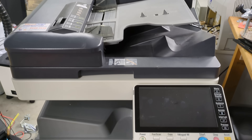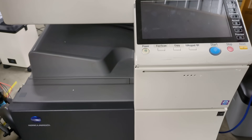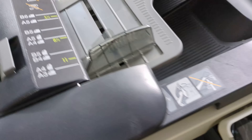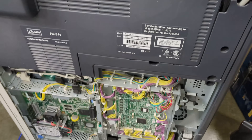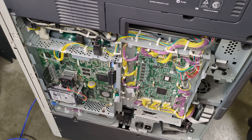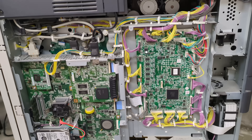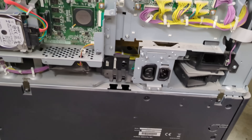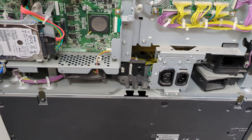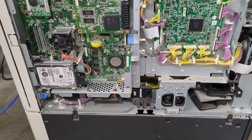Just an update video on this Konica Minolta BizHub that I scored from the dumpster — it's a C284E, colour jobby for those playing along at home. Does it work or not? Got it back here into the dungeon and... wah wah wah. It does absolutely nothing at all. So I took some panels off. I did actually find a service manual for this thing — believe it or not, it's 1,500 pages long. I am not kidding. It's insane! Haven't had a decent look, but I can't actually find the info for how to service the power supply or whatever. So I presume it's the power supply's bug. Here's the mains input — I whacked a power meter on it and I'm getting nothing. I measured it with a meter, getting nothing. And there's no physical manual power switch on it that I could find. It's an electronic power button, so I expect some sort of standby, but I measure absolutely nothing.